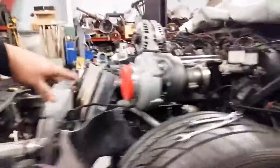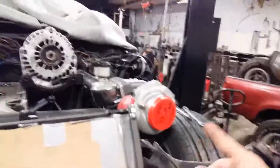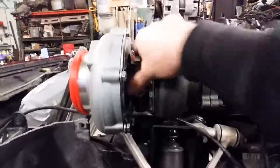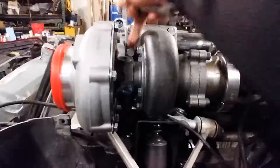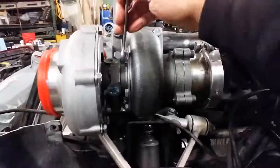Now when you go to mount these guys, as you can see the header is spinning up here and this one's spinning down. That's because when you buy these, they're very one-sided. You can rotate these guys — which is called clocking them. I've loosened all these bolts up here and I can grab this guy. Now this piece right here also moves by itself, so you don't have to go with just one. When you get it into position, give it a slight turn so we can shoot down through that hole, then tighten her up. Go all the way around, make sure you get everything in a tightened position again. You've got to follow the torque specs for this stuff.